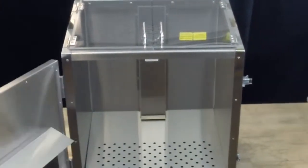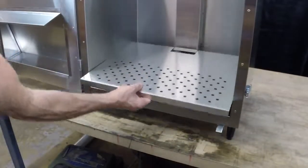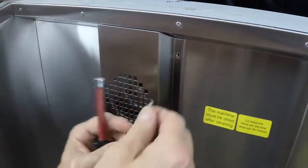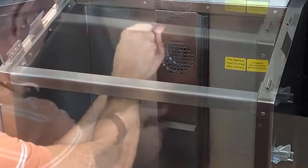Swing open the front panel and remove the grate from the bottom of the warmer. Using the quarter-inch nut driver, remove the eight fan cover screws. Note that the screws do not have slots, therefore a screwdriver cannot be used.